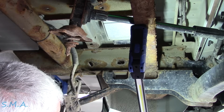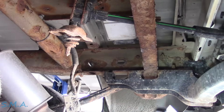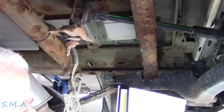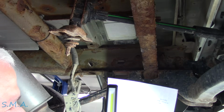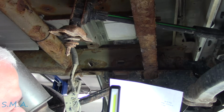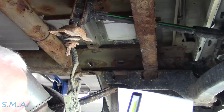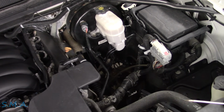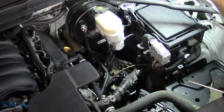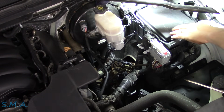No, sir. All right, let's let it down and check the fuse. What an idiot this guy is. Because now we need to know the ESC, ELH, EXH fuse. Electronic suspension, exhaust, something else. Electronic leveling or something. 30 amp fuse, underhood fuse box, left side of the engine. Let's go. No, Erico, you disappoint me. Go ahead and say it, folks. I believe it. Sometimes we preach it, we just don't do it.